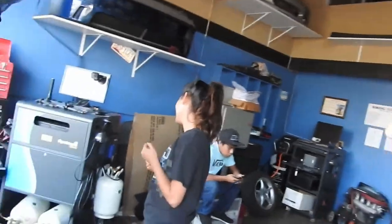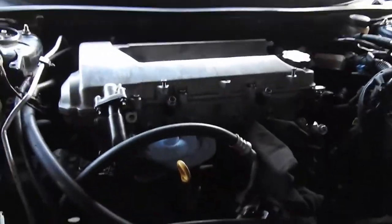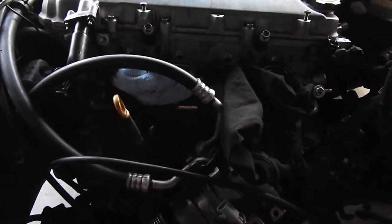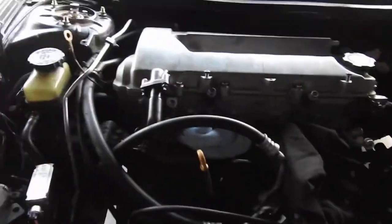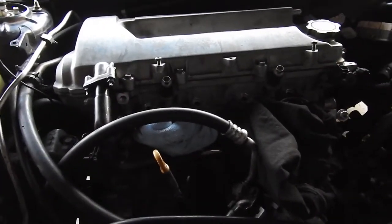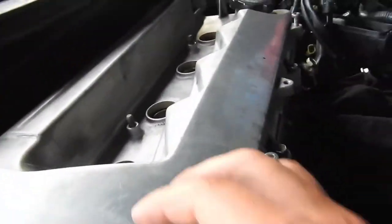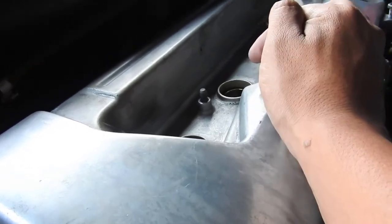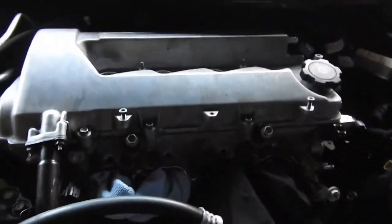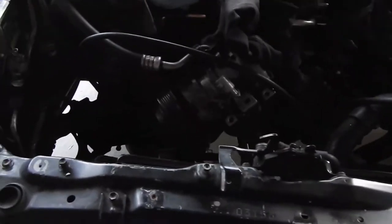Welcome to Rafa's garage. Today we're gonna try to do some Mickey Mouse work — we're gonna take off the header again and take out the spark plugs, look down there, see if there's any metal in there. If there is, we're gonna try to blow it out or take it out somehow. If not, I'm gonna need to take off the motor and take off the head.